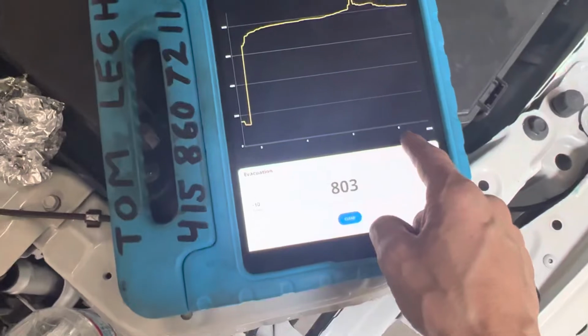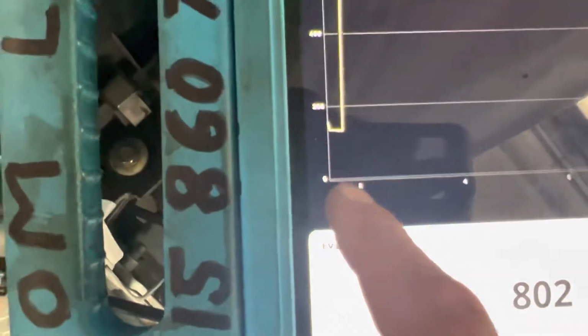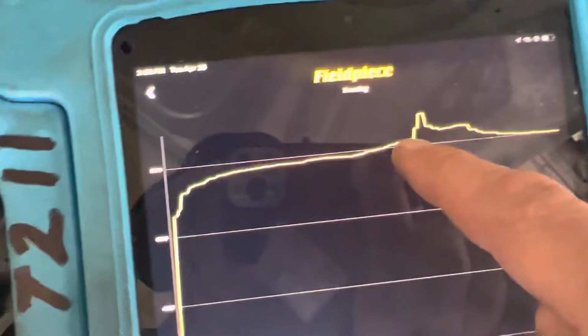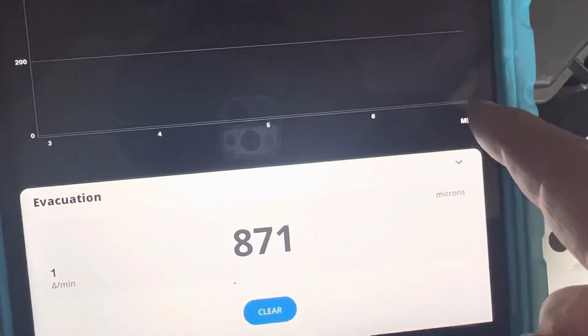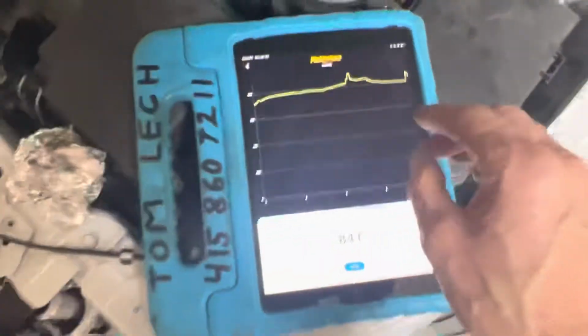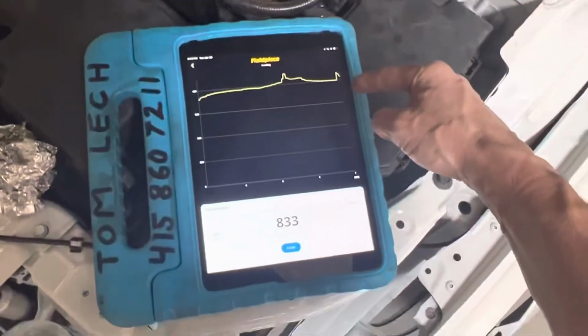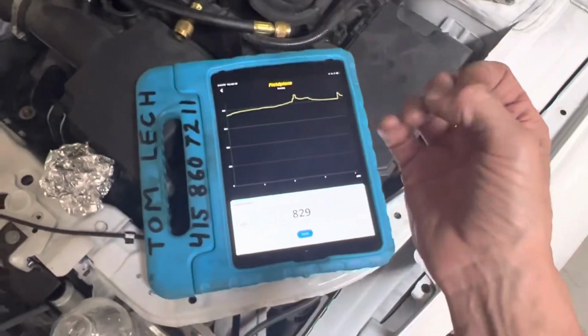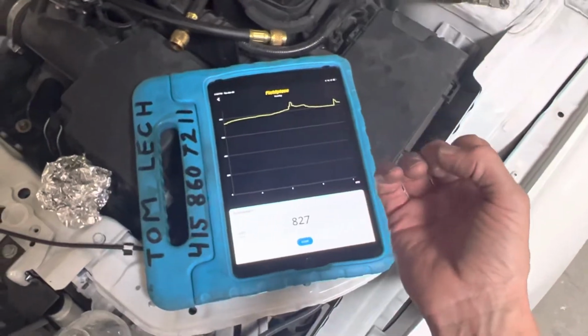And then as time goes by, we're into 6 minutes. I turned it off at the 3-minute point, roughly almost 3 minutes. You can see where I turned off the valve and the vacuum rose, and now it's starting to level off. We're approaching the 7-minute point, and it's having these little outbursts. Those little outbursts where you see it jumping like this are like steam pockets bursting out, refrigerant buried deep down in the oil bursting out.